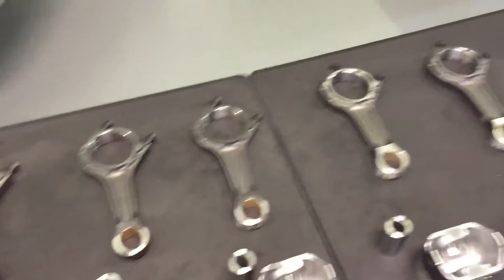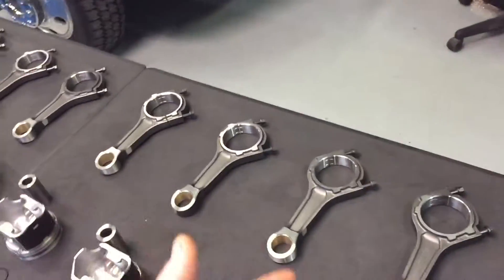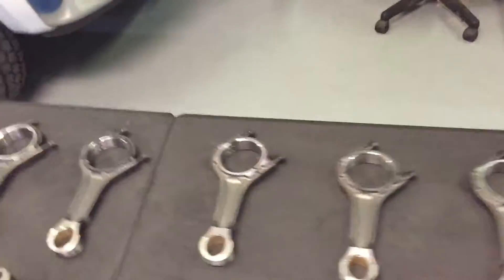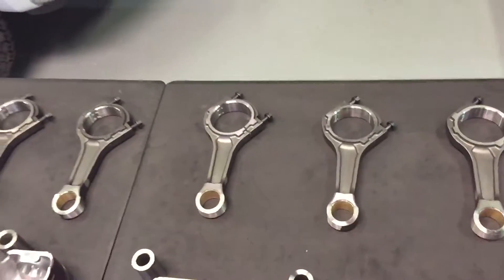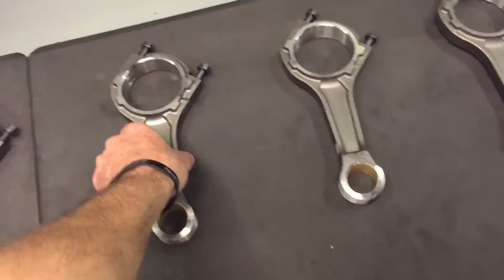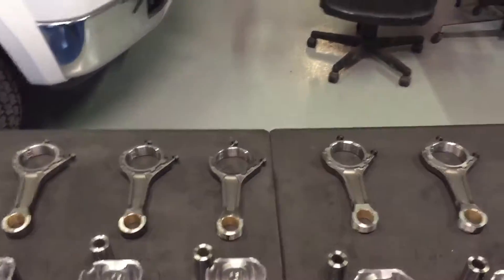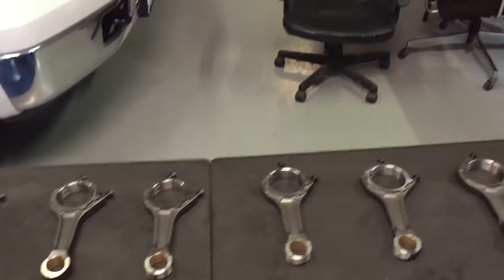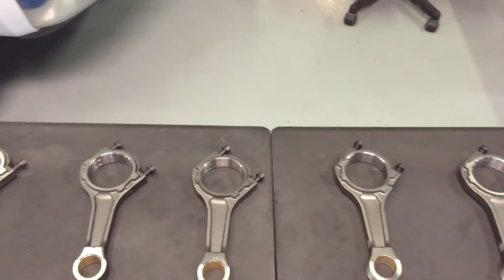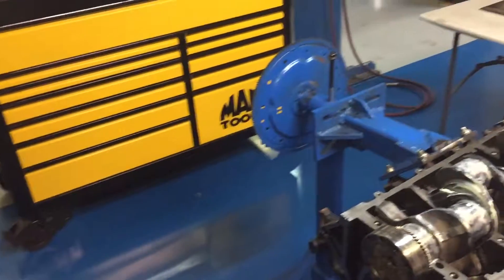We replaced all the rods, just because rods are 800 bucks for a set from Ford. It comes with the bearings and the bolts, so you save a little bit there — maybe a hundred bucks — and you get new rods. The bushings are going to be new. To press a bushing in, I've had them go 45, 55 bucks, sometimes as cheap as 35. Because these are tapered rods, they take a special jig and not many people do it. So by the time you spend even 40 bucks to push the bushing in, buy the new bearing, and buy the bolts, you're pretty much there — why not just buy a new rod? Plus with the damage we had on the crankshaft, you know, it bouncing around 120 thousandths side to side, it's better to err on the side of caution when you're looking at a big ticket.